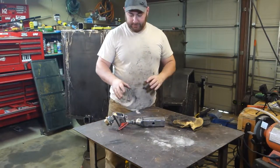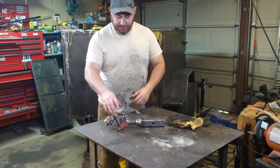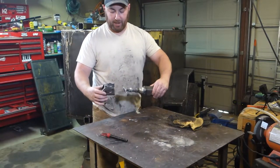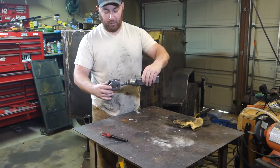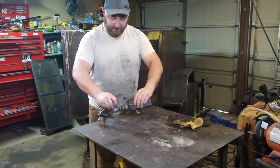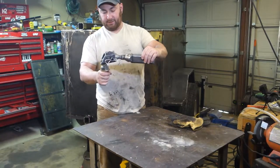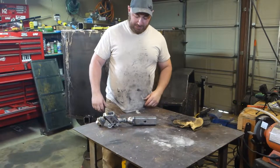Here's our completed coupler — all that's missing is the truck end. Basically this arm will connect to the truck. Now you can see we can rotate this way, we can rotate this way, and we can rotate this way. I'm going to paint all of this — it looks a little dirty — and we need to fill it with grease so it'll work a little better. Whenever you show up at a campsite you basically just pull the pin, pull this off, and the truck drives away while this remains with the trailer. When you're ready, you slip it in — it sits in this cradle so you don't have to hold the weight while you're putting the pin in — then pin slides through, pop the cotter on, and you're ready to go.